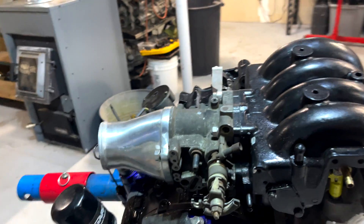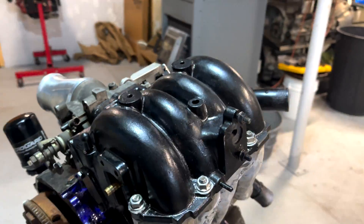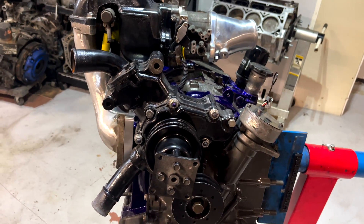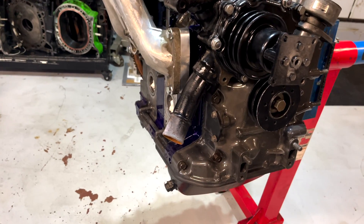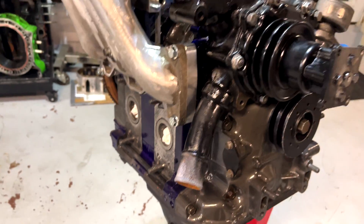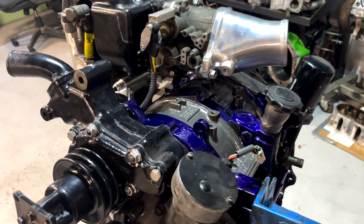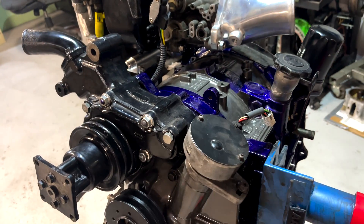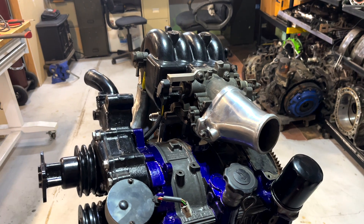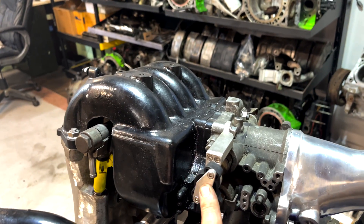This is what it's going to look like on Mike's motor: turbo tube intake manifold, turbo tube fuel rail. He's deciding whether he wants to go with an electric water pump and he's still deciding on turbo, so the front cover may have to come off so I can weld a bung for the turbo oil return — either on the front cover or the oil pan. We've also brought this thing into the 21st century with a crank angle sensor for the FC, because we're probably going to go with one of my Microtechs.